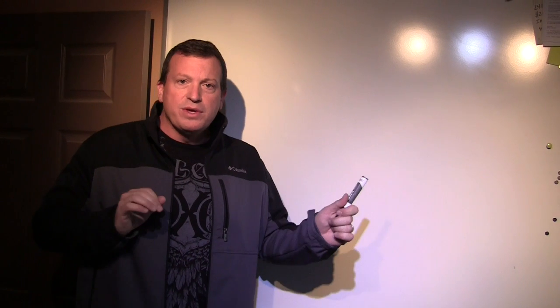There's going to be those people out there that are going to write, oh, you're not exactly right. This is just for learning purposes, and it's just going to come from the top of my head from 30 years of experience. And what I'm going to show you is how bass works with these different types of enclosures. Once you understand this, it'll give you a firm grip on what to do with your speaker boxes.